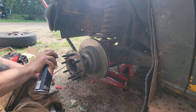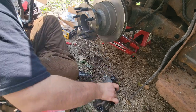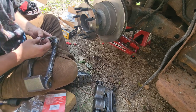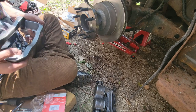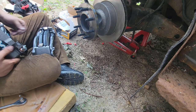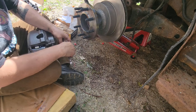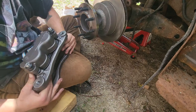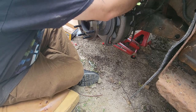Next step: clean the front side of the rotor again with brake cleaner and go into the calipers. There are two parts to the caliper for my particular bus — the caliper and the bracket. In my hands right now is the bracket. I am putting the brake pad shims onto that bracket. It is very important to make sure you are putting those brake pad shims on correctly, because if you put them on incorrectly, they run the risk of dragging against the rotor and that will cause damage. Once you've got the brake pad secured inside the bracket, you put the caliper back on and tighten up the two hex bolts on that other side. Tighten those two bolts up and put the brake line back on. Make sure that's tight.